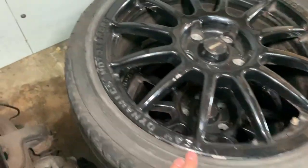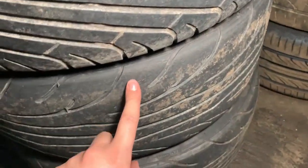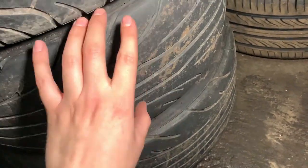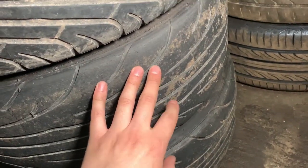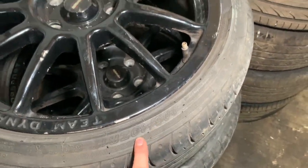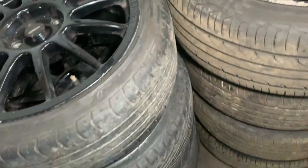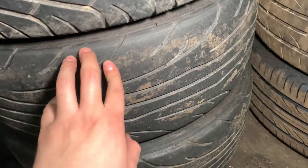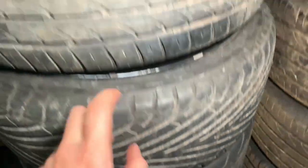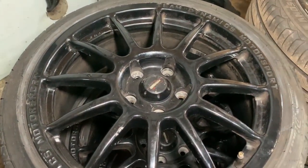They do have some budget tires on the rear, but obviously we're front wheel drive. The ones that are important are these. These are some Nankang NS2Rs with plenty of tread left on them. They are 205/40 R17s as opposed to the 225s on the standard wheels, so we will lose some width, but hopefully with the stickiness of the NS2Rs, it shouldn't be an issue. But if it is, they are 7J rims, so hopefully we can whack some 225s on there and get the width back.